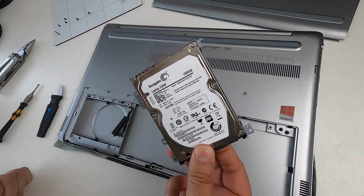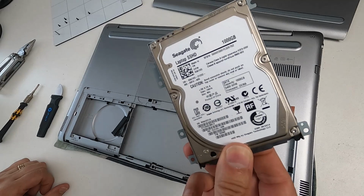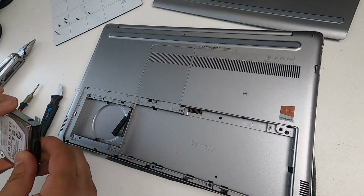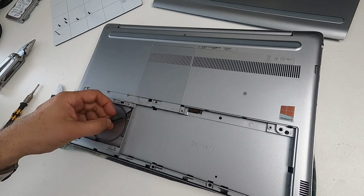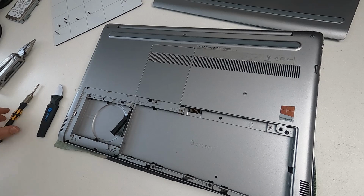I would say the essential upgrade for this particular laptop is to replace that with an actual solid state drive, because that's going to make a whole world of difference. It's going to be absolutely incredible with that replaced. But that is the original drive that came with it. And you notice there's a loose cable there that's flapping around. Don't try and remove that cable because it's attached inside and we can't take it off without removing the back cover,